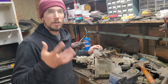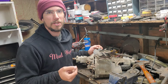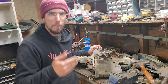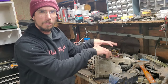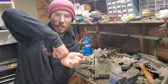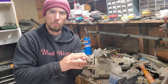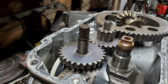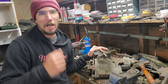What was interesting was that at 150 feet it was actually still accelerating, but the motor was just bogging down. With these hydros you have your input pulley here, which spins like this, and your output spins to the side. The input was torquing up the output onto that gear we installed, and we chose a gear that was just way too big — it did not have enough takeoff torque, so I blew it up.